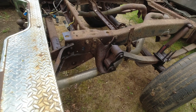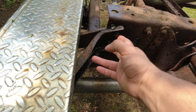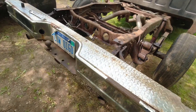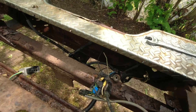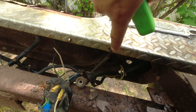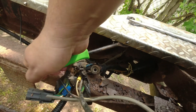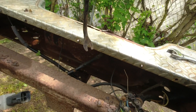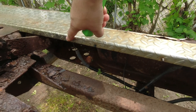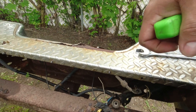Before I start cleaning the frame and C-notching, I'm going to start removing the bolts for the bumper. There are six of them at 19 millimeters, and this bumper is coming out. Before I move the bumper, I still have the wires hooked up to it. There are some clips along it — you can see that little clip right there, and another one further across. Just take those off so you get the wires free and don't mess them up.